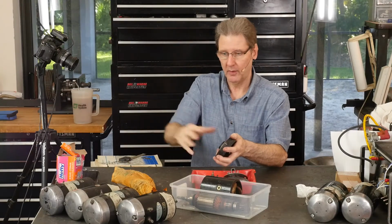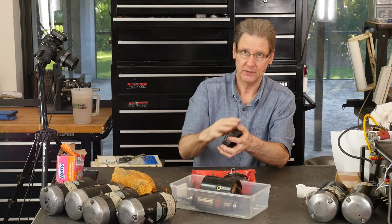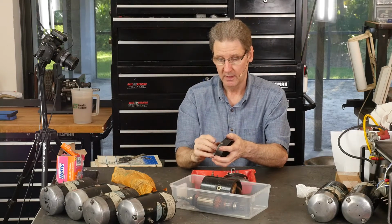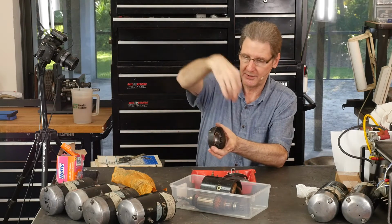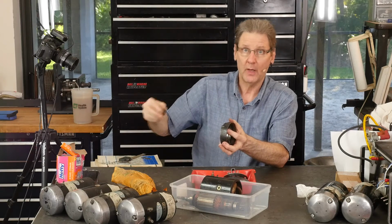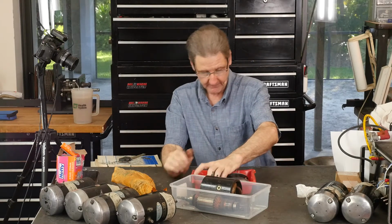Because this is where the oil is. The bearings in this new 65B are sealed bearings. So it doesn't need any oil splashing on the inside bearings like the way the 65A does. And if you think about it, that's how it goes in the same orientation, but over on the other side in the 65A, where you do want engine oil to splash onto this bearing. So that was the first trick, 1-inch socket, worked good, tapped it out.